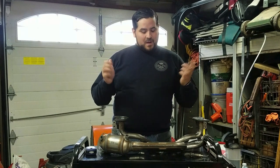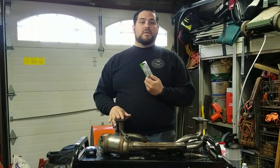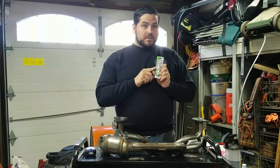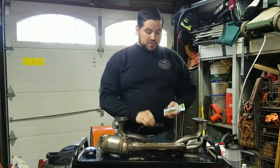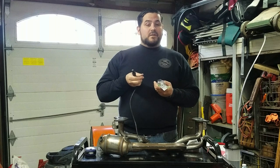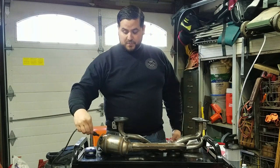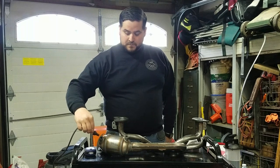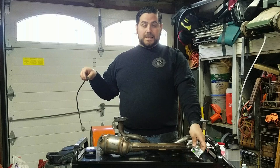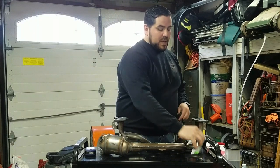Subarus love them. I'm here today to show you a trick using spark plug foulers. It's very simple. You take a half-inch drill bit, drill one of them so that the O2 sensor can seat nicely into the first fouler. Then you take the second fouler and screw it into the first fouler, so it will sit just about an inch and a half out, and it should read cleaner exhaust gases from being further out because you still have a hole.